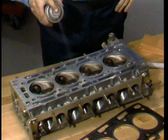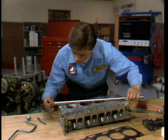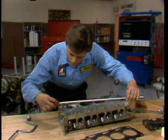On the other side of this disc, our first half, we explained the basic design of wet-sleeve engines. We also went through a few key servicing procedures that are special to the wet-sleeves. Now on this side, our second half, we're ready to run through step-by-step liner and piston replacement procedures. Here we'll be using our 2.2-liter type J engine. We'll cover head removal using our shearing technique and liner clamping. Along the way, we'll also take time out to get into head and block cleaning and how to handle aluminum components.